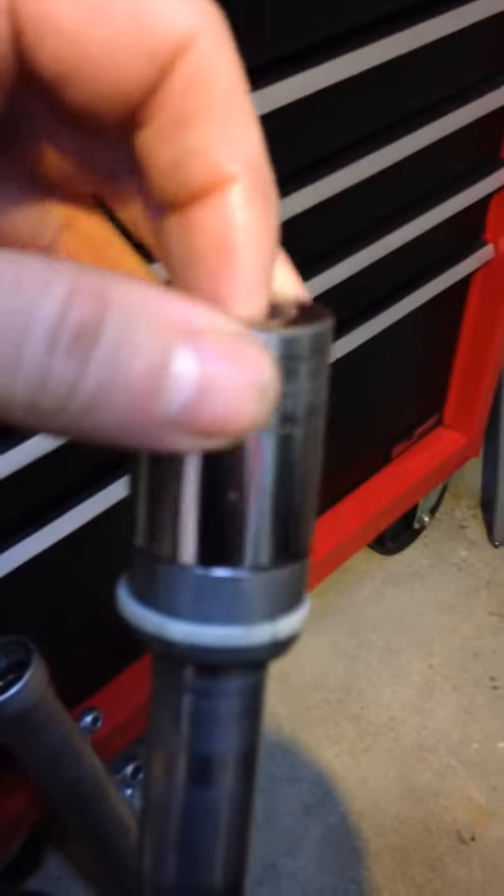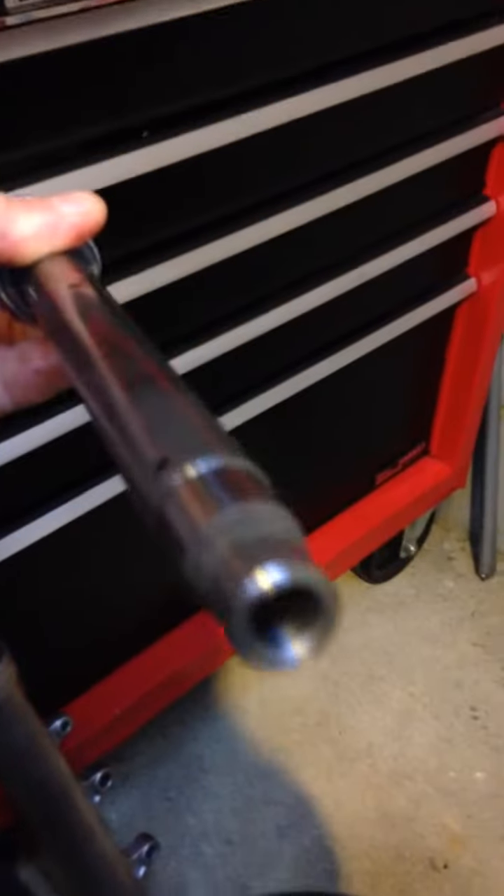Like that — just enough protruding. This then allows a 24mm socket to locate on, lock, and through two extensions, hold the damper rod in place, so you can hold it while you unscrew the allen bolt at the bottom. This 24mm socket does fit easily inside the tube without any problem at all.